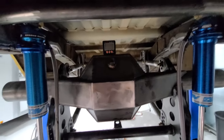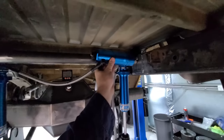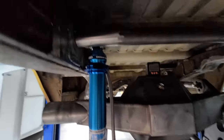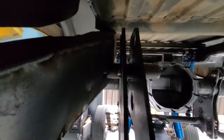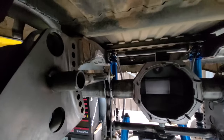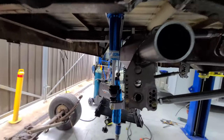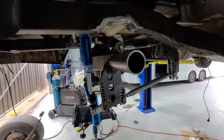I've been using this digital inclinometer to get everything right and how it should. There are little gas shocks and I'll probably get them mounted up around this somewhere. Four link up the front here — I've only just got that through there and just tacked it, just temporary. This bar in the middle has got to come out obviously because the tail shaft's got to run through here. But overall we're looking pretty good. There's six inches of travel in these rear shocks. The notch turned out pretty good. Progress.